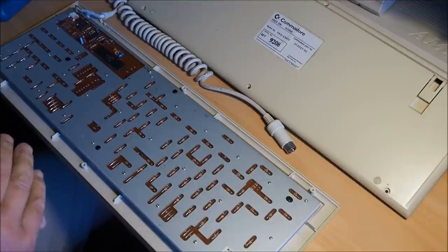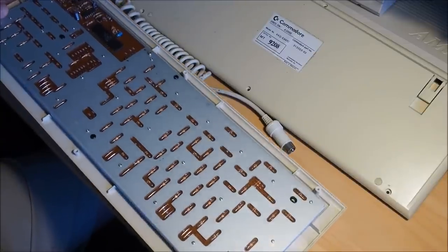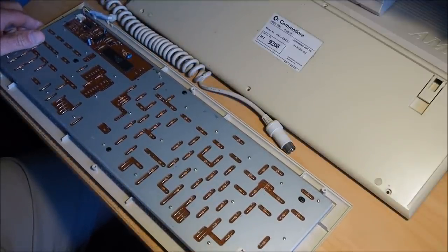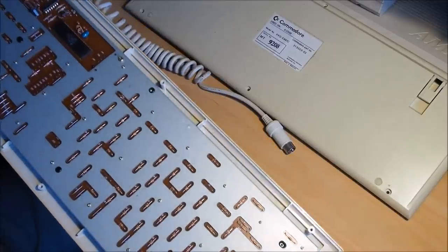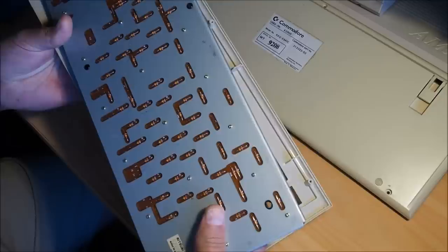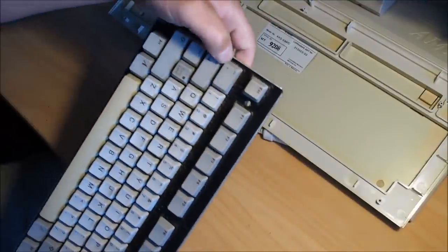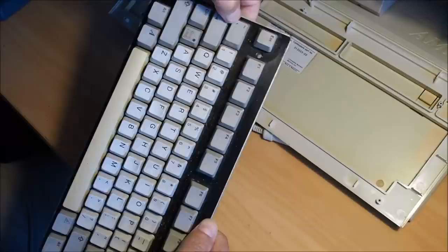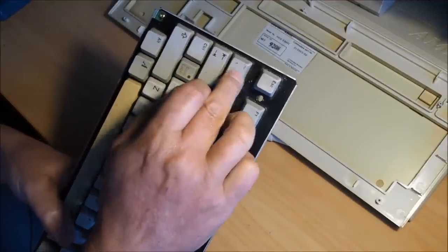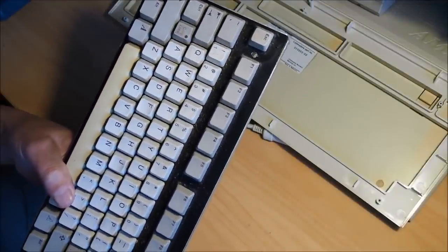But what I possibly didn't do was test it for long enough, and with those other cards removed. So I thought it was the accelerator card causing it, so I put another accelerator in and I saw the problem happen again. So then I was sort of convinced that it was an accelerator card issue. Anyway, I tried another keyboard, an Amiga 2000 keyboard. On that one, this key, the one below tilde there, was repeating. It didn't appear to be stuck. I was tapping it and it wouldn't do anything. No other key would respond. So that's actually a faulty keyboard, that Amiga 2000.